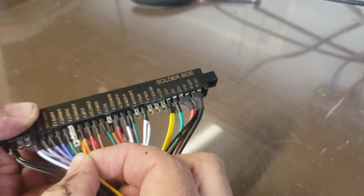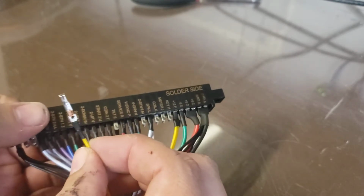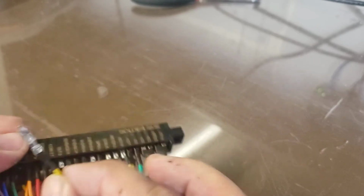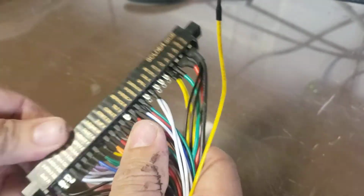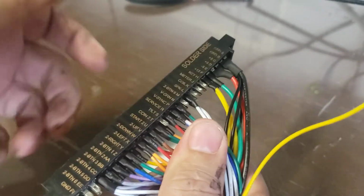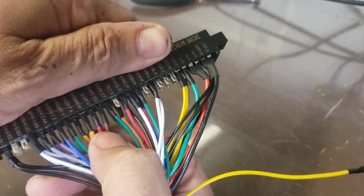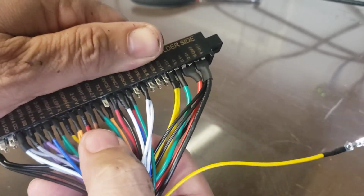This is one of the biggest issues that I found after a joystick switch or something like that, right in here in this little connection. I noticed that sometimes it's our fault, or it could be the manufacturer's fault. I have no idea. But what I do know is that at times we put our thumbs here, and we grab the cartridge into the game board, and we snap it together. And when we do that, you never know if you're flexing these guys too much, and you could be popping them. You could be popping the thing out.